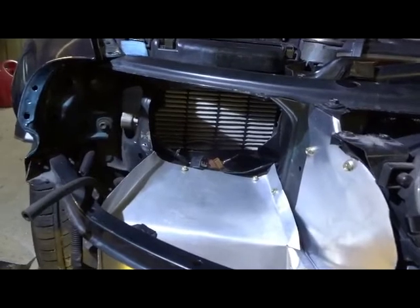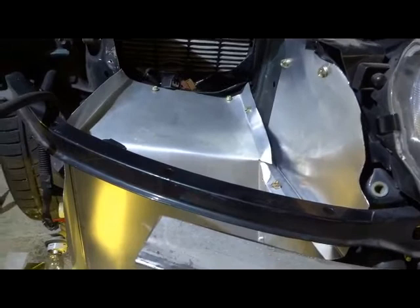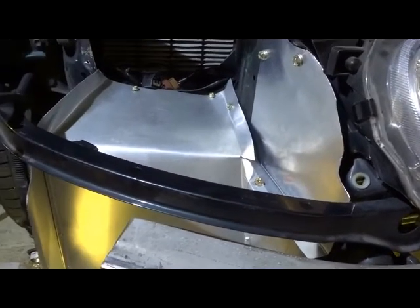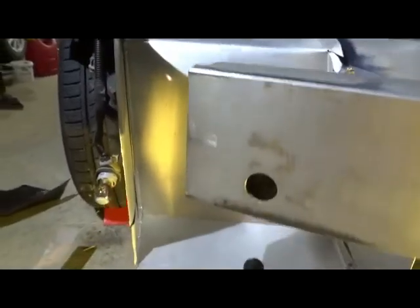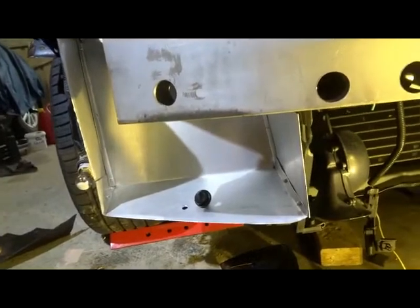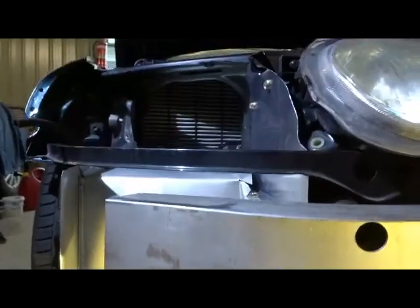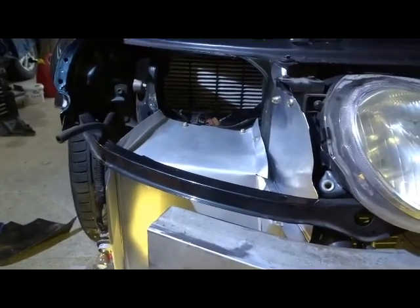Okay, this is the big air filter setup modification. I used to take the ducting through the front grille, but now I've had to block that off because it's now used for the intercooler, and I've taken the intake down below here, which will go into a couple of holes which are in the front cowl, etc., where the air can come in, and it'll come up in behind under the headlight and into the cool air box.